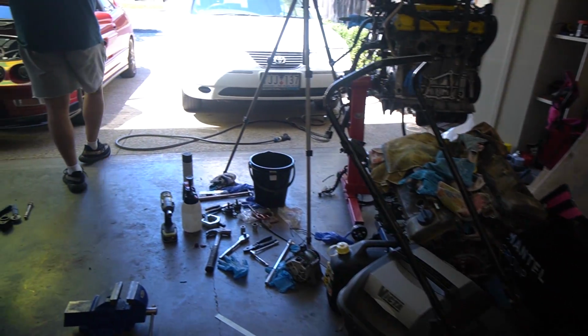So the MR2 from factory, when you lower them, they feel okay. So when you drop adjust and coilovers, it mucks up the suspension geometry and how all the arms move. I explained it in the previous video, but I'll explain it again. The arms will sit at this level at stock ride height, and when you lower the car, they will come up. That will mess around with the suspension. It'll make it react different to bumps and all that. So the way that you can correct the weird feel, the bump steer, is by spacing all the arms down.